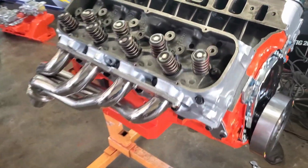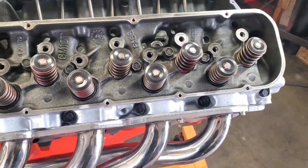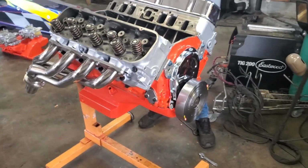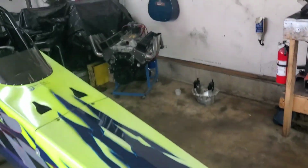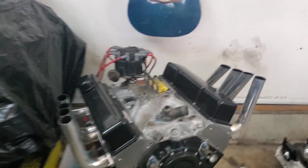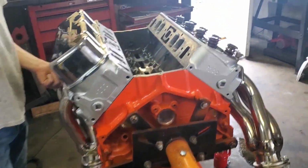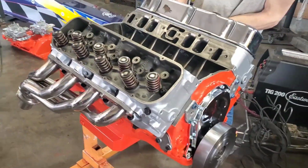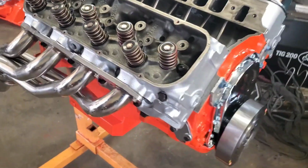Got this other head on, and got all of those. I think I already talked about, I got all those plates, those guide plates corrected and in line. So first of all, before we get the intake on, since it's kind of a weird thing and we can't use a puller like what's on this 355 over here, since we can't use that because it would throw it off being on one side, I think we're gonna go ahead and throw the motor on this way and just use bolts in the heads and a chain in order to lift the motor into the test stand over here. And then we'll go ahead and put the intake on from there, and I'll keep working on this side of the head with the rockers and the guide plates and push rods and everything like that.